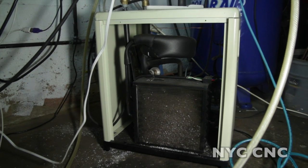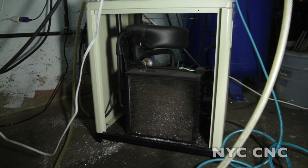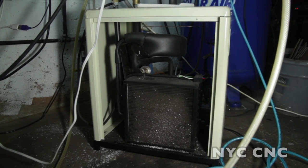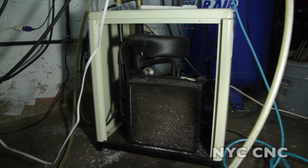Just a word of caution: if you've got one of these machines and you're having problems, I would clean out the drain, make sure your radiator here is clear, and make sure you keep the unit away from a wall so that it's got area to breathe and air to circulate around it. That's all folks, thanks.